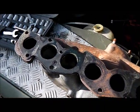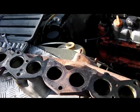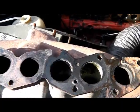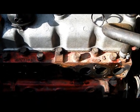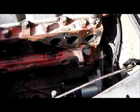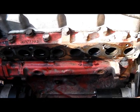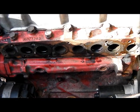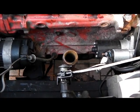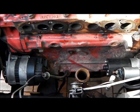The manifold came away fairly painlessly, but you'll notice there are a few splits in the gasket. Also notice the oil — it does use a little bit of oil; I think I put about half a pint in a week. It's a lot less than it used to be, but I don't know what's typical of these engines. Perhaps at some point it'll be time for a cylinder head rebuild. I've also released the exhaust at the other end, so that's basically ready to drop out when the time comes, and it gives a bit more clearance for the new manifold.